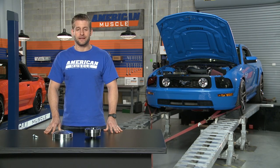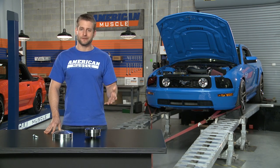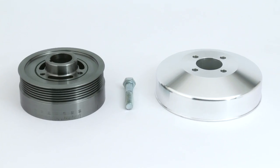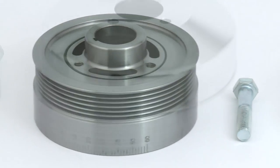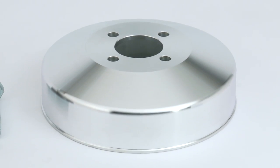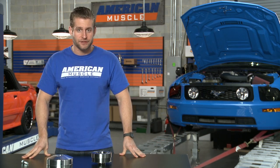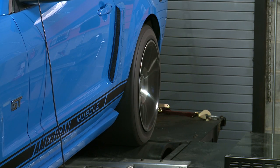Engine accessories like the AC compressor, water pump, and alternator can really rob your car of valuable horsepower. A great example of how much power an accessory can eat up is to think about whenever you turn your car's AC on and instantly it feels a little more sluggish. This is referred to as parasitic drag. The job of an underdrive pulley is to turn the different accessory pulleys at a slower rate of speed by using these different sized pulleys, thus requiring less power from the motor to drive each accessory. This reduction in drag on the crankshaft should allow the motor to work more efficiently and essentially equate to more power at the rear wheels.